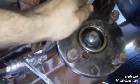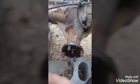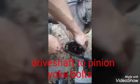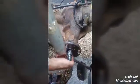Tighten it down to get absolutely all the slop out, and then it's going to start to feel a little bit hard to turn. It's about 25. The method for tightening this without fancy equipment: leave at least two of your bolts that go into the flange and pinch them with something like this, get down with a brick to give you a solid surface so it's not going to go anywhere. When you go to turn it you're going to need a big breaker bar with a long bit of leverage for this.